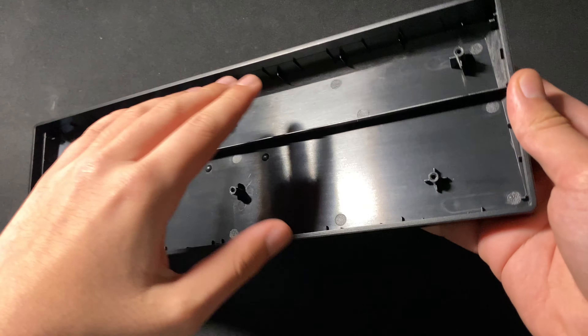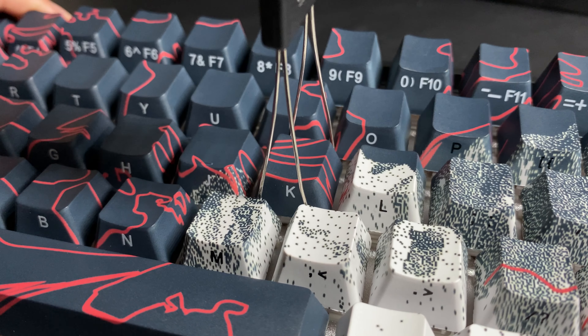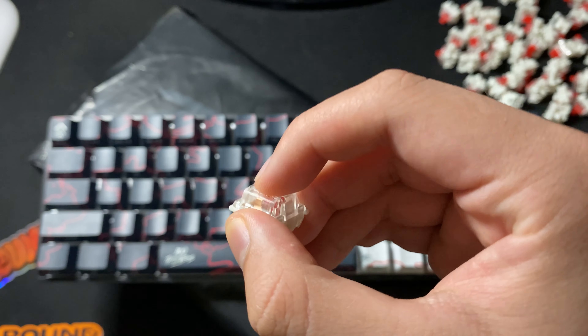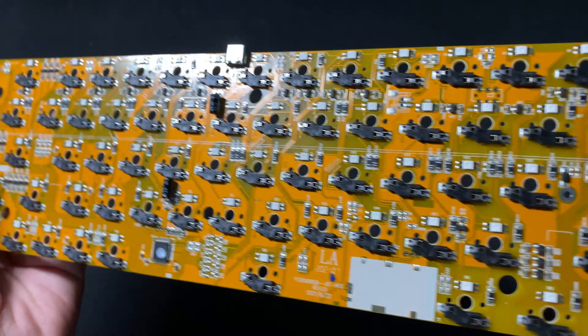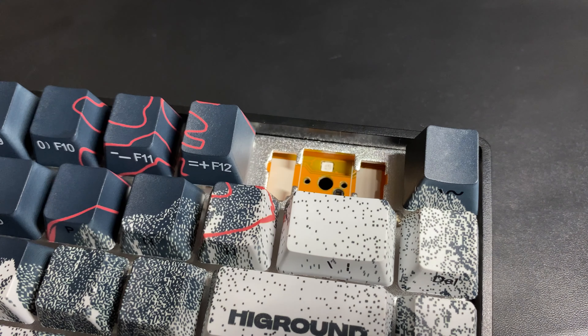The Geostone comes in a plastic case with a grey aluminum mounting plate. There aren't any flip-down feet, but there are four large rubber feet in each corner of the keyboard. You only get one option in terms of switch selection, and that's the Gateron Reds — they are unlubed and 3-pinned. I would have liked to see at least a tactile and a clicky option available, but the keyboard is hotswappable with support for 5-pin switches, which I think is a great feature.